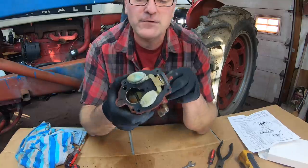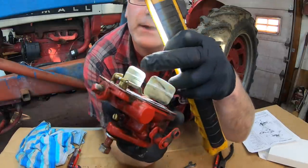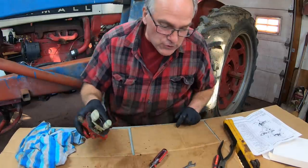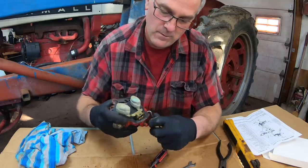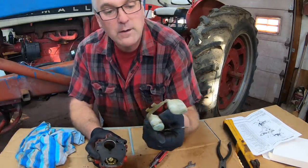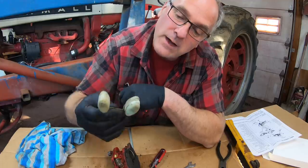We've got to take this top part apart. The first thing I want to take off is the float, because it's the thing most likely to get dinged up when I'm messing around. These floats are just retained in this clip by friction — there's just a straight pin in here, so you open up that slot a little bit and then the pin will slide out with a small screwdriver. Slide the pin out like that. Then this is the float — you shake it around, and if you hear sloshing you've got a bad float with a pinhole somewhere. I don't hear anything but a little piece of solder, and it's empty, so I know this float is all right.